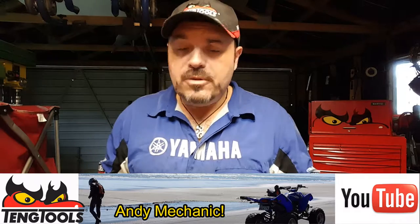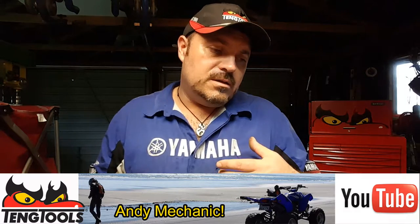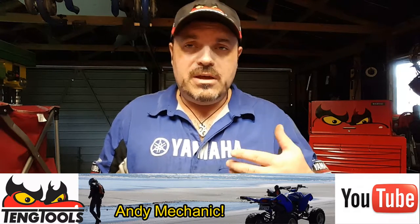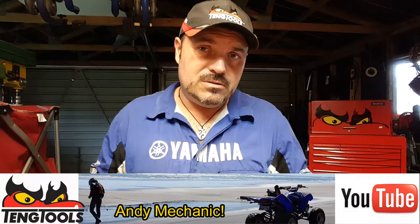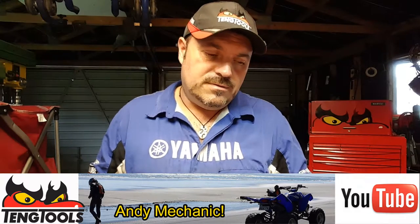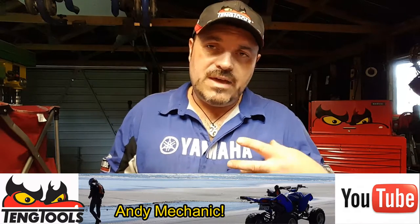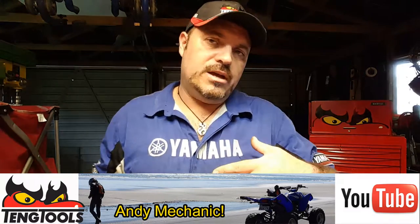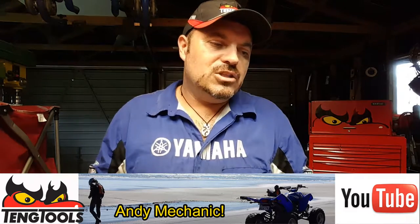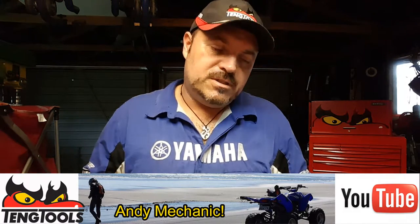So there you go. I hope you found this video, this short video, helpful. It might not be too short, who knows. Working out what's bent on a vehicle sometimes can be quite difficult. The manufacturers don't give you specific measurements very often. And if the bend is very slight, then it can be actually quite difficult to find. So, when you're looking at components, look for the easiest part of that component's test first. Because if that's a fail, then you're going to be replacing the component. You don't need to try and do some really extensive measurements to ascertain whether or not that component's got bent on the more intricate parts of it. Check the easy bits first. That makes your life a lot easier. And that's most definitely helped me out an awful lot on this particular inspection.